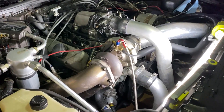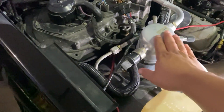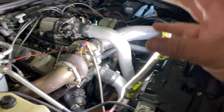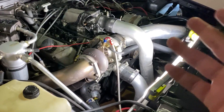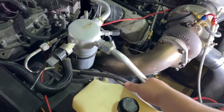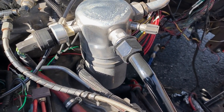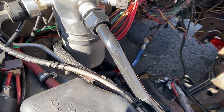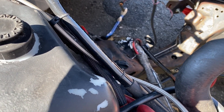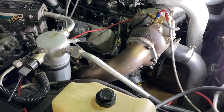I did textured black on the '87 and that worked pretty well with the black pearl on the engine, but on this one I'll keep it satin and gloss — simple. I've got to powder coat everything you see here. I'm also going to hand paint all of the bare aluminum. Enamel paint works very well on this — you just scuff it and hand paint it with a brush, it flattens out on its own without thinning and it actually looks like a powder coat. It held up very well on the '87.